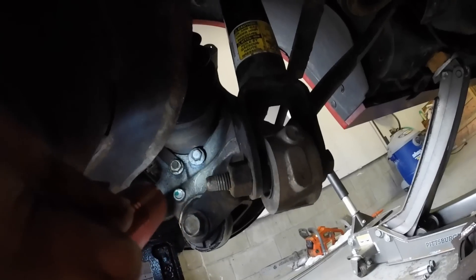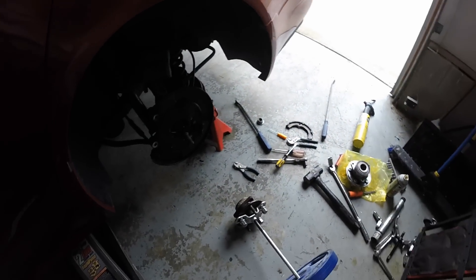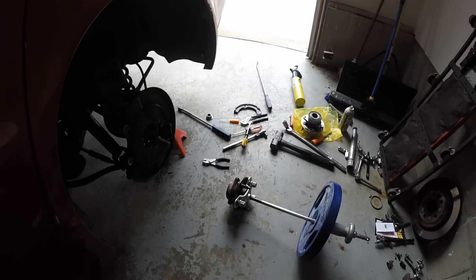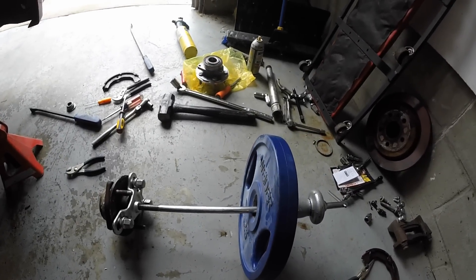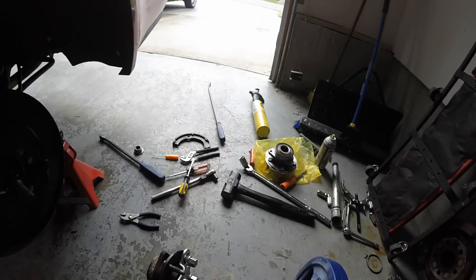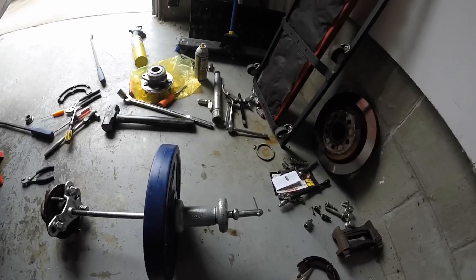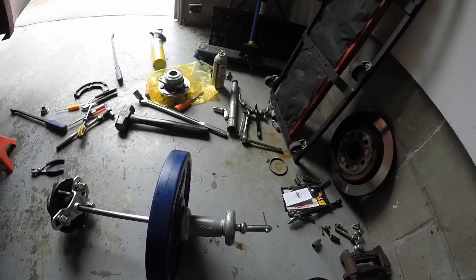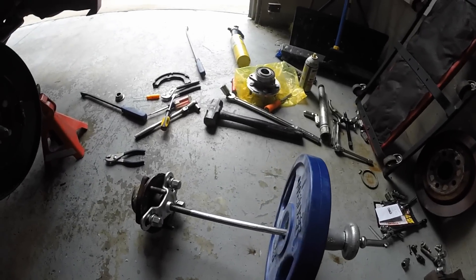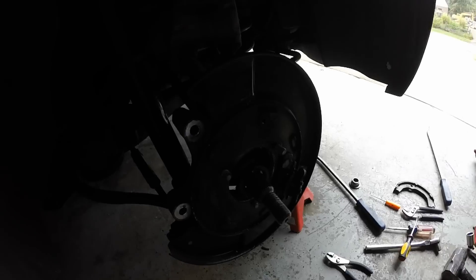I finally got this old wheel bearing off, and this has got to be the hardest wheel hub assembly I have ever had to remove. I spent a couple hours on it last night and a couple hours this morning — trying heating it up, pry bars, sledgehammers. What ultimately worked was going to Advanced Auto, where they had a slide hammer you can rent for free. With just the basic weight it wasn't enough, so I went down to my gym and grabbed an extra 25-pounder, and after about six or seven really hard tugs the thing finally broke loose.